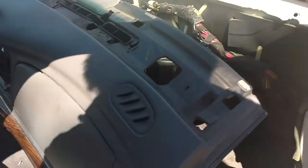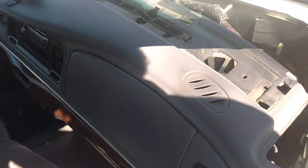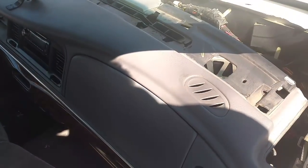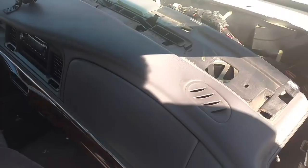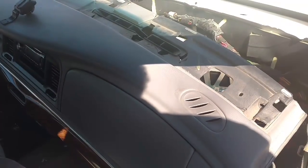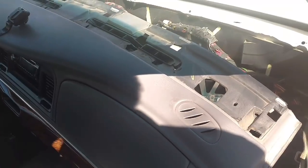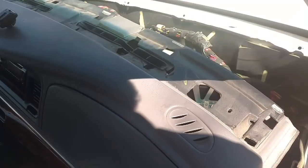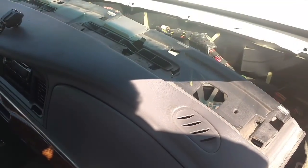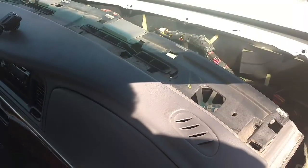Now in this vehicle, unlike the one in the video that I linked in the comment section, the screws won't come out through the firewall unless you take something out in the engine compartment. There's some kind of way that they're secured into the firewall. Now when I get the box up there and the top screw is lined up, the bottom 2 are not.